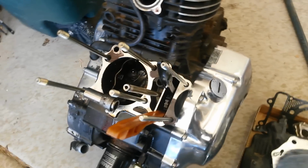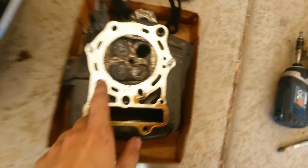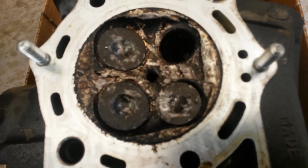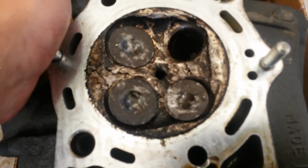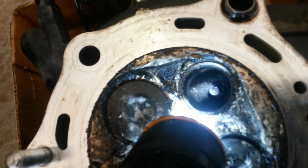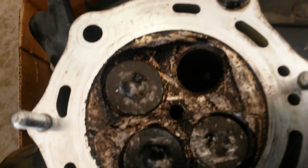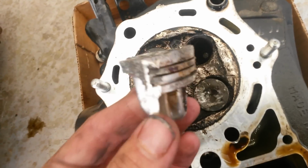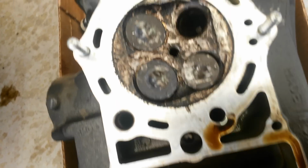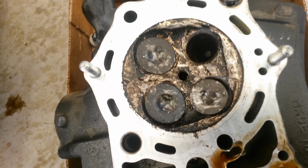If you have a Vulcan 800 motorcycle, you need to be checking your valve clearance every 6,000 miles per the manual. Otherwise, this is going to happen. It dropped a valve. The valve clearance gets too tight, and the valves don't have any room. The head starts overheating, the valve seat starts overheating, and I've actually seen a couple reports on the internet. The valve just snaps off and drops down and shells the engine. That's the piston. That's what's left of the piston after a motor dropped a valve due to improper maintenance.